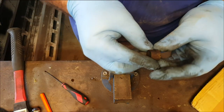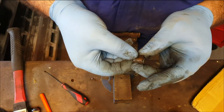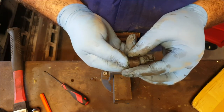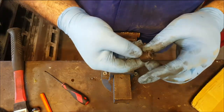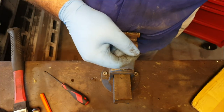So you can see, and you could tell by the video actually, the piston was pretty seized in the bore, took quite a lot of effort to move it, hence the problem of the efficiency on that brake. These pistons are not being pushed out by hydraulic pressure, and we're not getting the brake shoes being pushed against the drum. Essentially that brake was doing nothing, it was ineffective.